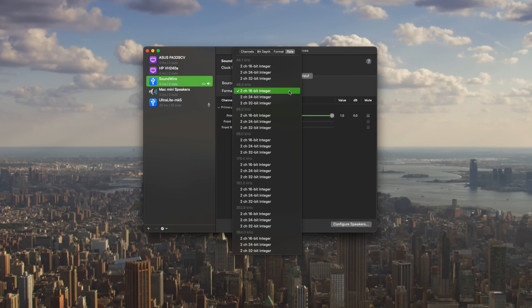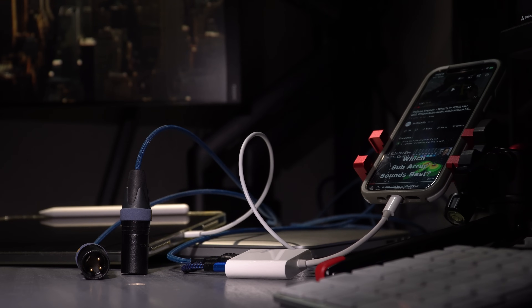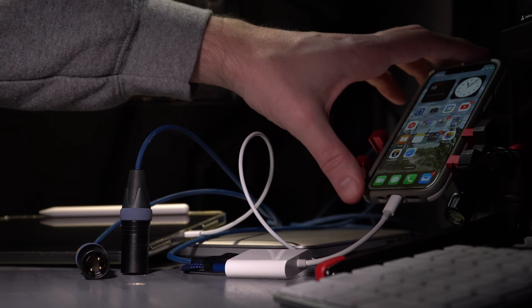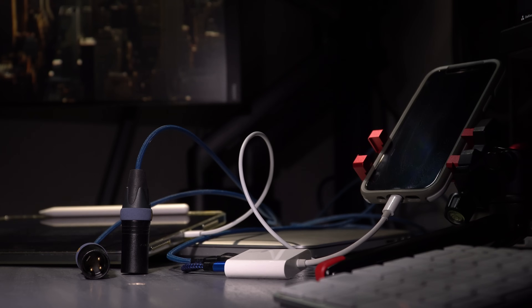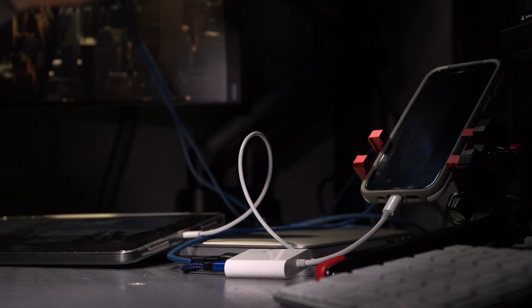On the audio side, the Sound Wire can operate at many different sample rates and bit depths, from 44.1k up to 384k if that's something you need. On the quality side, I can't tell any difference from the source file when I AB them with matched levels. With transformers, you always have the risk of saturation and changes in tone, but I haven't noticed any significant difference, at least not when playing back music and video files.